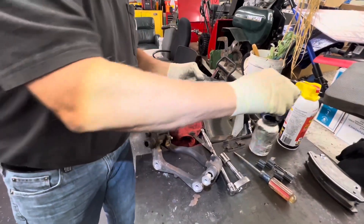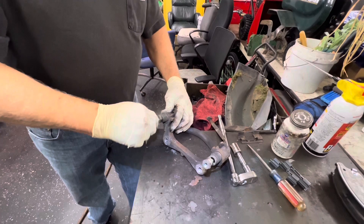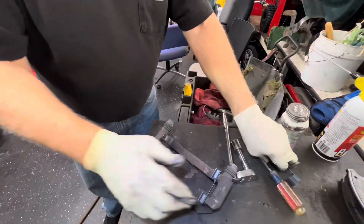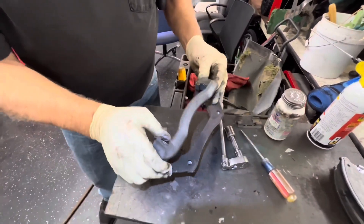You want to keep that rubber boot caliper pin in the same position. Get these lubed up nice, slide them back down into the boot, and twist them. See how they're pushing out? That's what you want. This is the one with the rubber on it — that one's good. Center those, push them down so they're nice and flat.